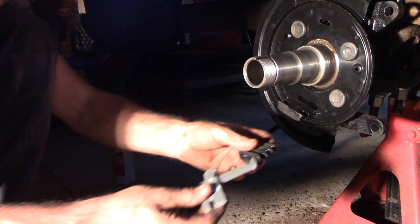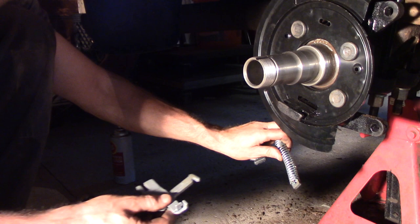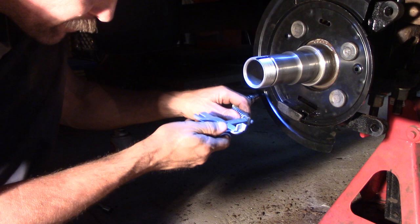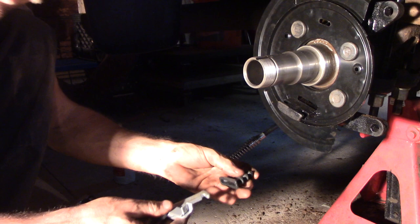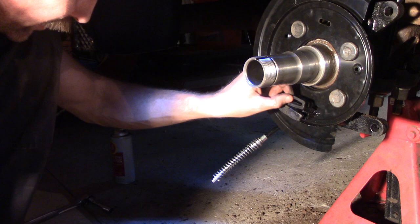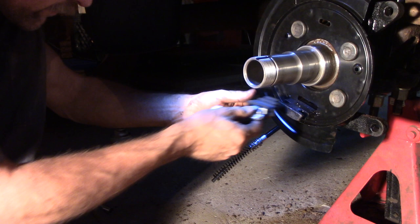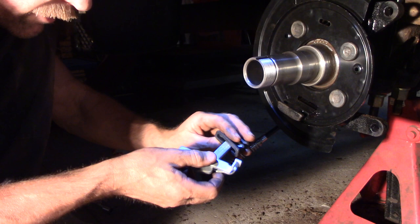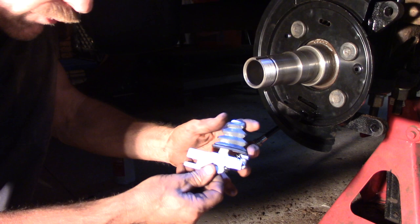I was going to try it from the rear side, but this part that's seized — it's got to have a rubber boot that goes in it. First of all, it's got to go this way because your cable is coming from the back side and it's got a hook in here. I'll have to pull that cable out a little bit. I found from the other side that putting this boot in first and getting it into the groove works better — if you try to do this all at once, it's kind of cumbersome. I put a little lube on there and get this thing in the groove, then you can put the lever through.